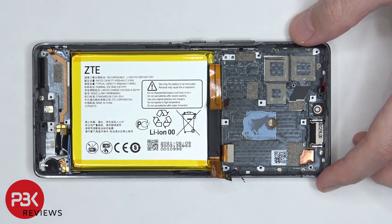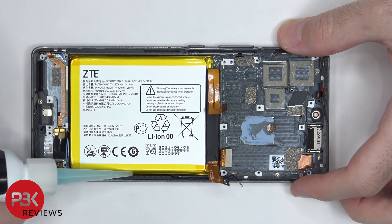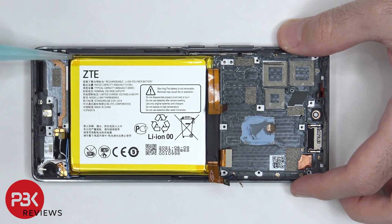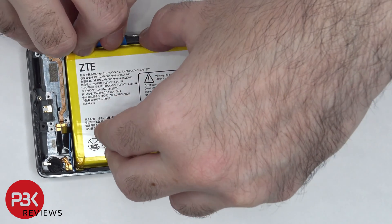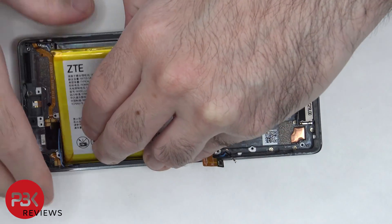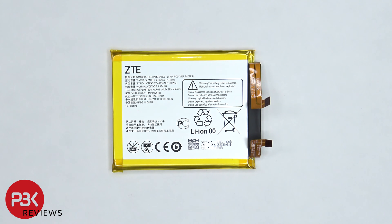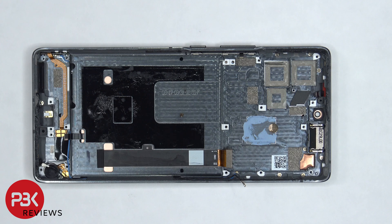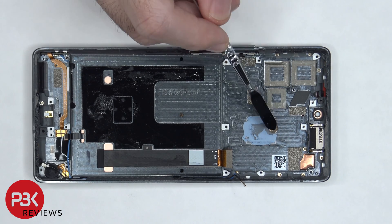In order to remove the battery, there are no pull tabs provided to help us pry the battery off, so we're going to have to use some isopropyl alcohol. Get it on the edges of the battery and let it sit there for about 30 seconds to a minute, so it eats away at the adhesive underneath, making it easier to pry off. Here's a better look at the battery. There's a copper vapor chamber in between the frame and the screen, so we can't really see it too well. However, it runs underneath the battery as well as the motherboard. You can see a little bit of the copper through this hole over here, and over here. There's also a small copper heat block on the top right.